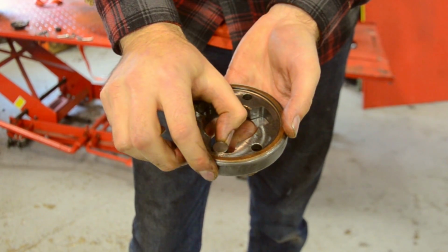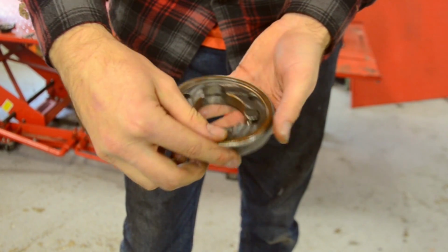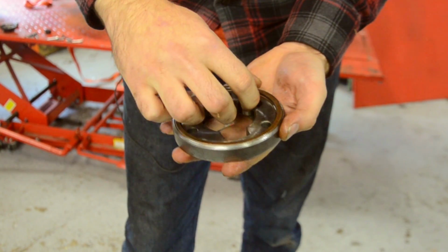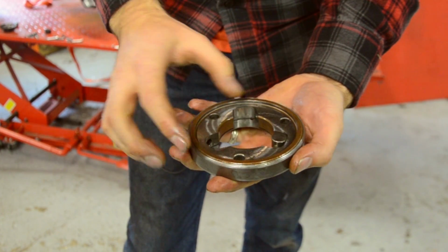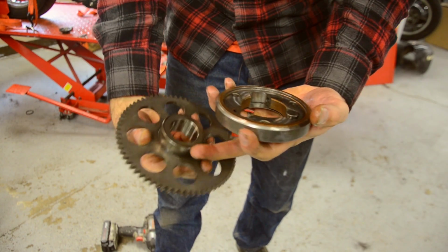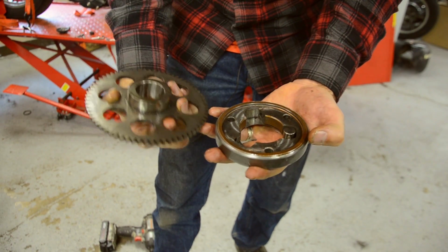Okay, so here's the roller and pin setup. They're slightly offset from the center so that when it spins in one direction, it is allowed to slip and freewheel. But if it spins in the other direction, it actually comes toward the center of the circle, and all three of them together squeeze down on that center gear. This outside diameter here is what is gripped by the set of 3 rollers.